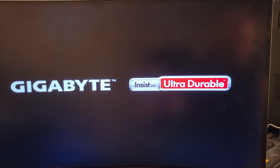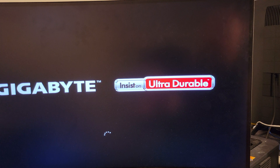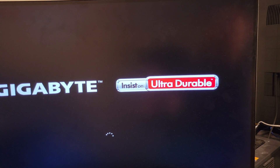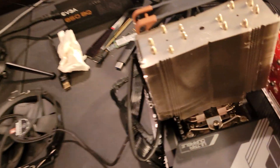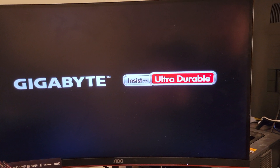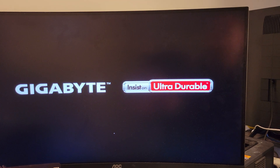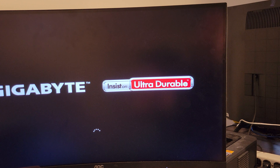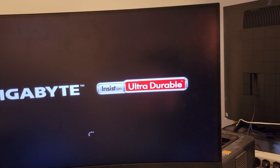Of course it's going to update right now. One thing I made on one of my other channels was a video discussing things you could do to get your temps down on these 13th gen CPUs. One thing I failed to mention was an aggressive fan curve, changing the default from silent to normal to full, and switching out the fan for a higher RPM one. Going from 1500 to 3000 RPM gives you a four or five degree temp difference. For benchmarks, great — but for gaming this may be too noisy unless you're wearing noise-canceling headphones, and for recording this would not work unless the computer was in another room.